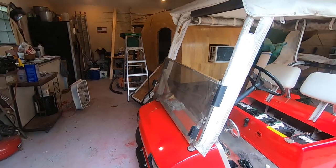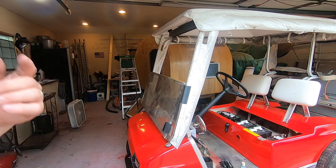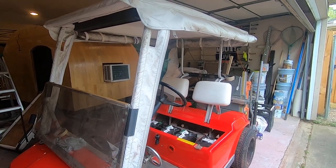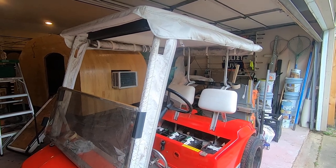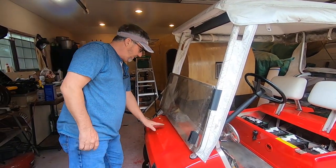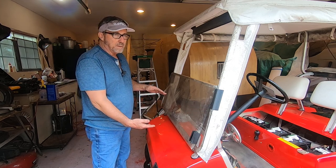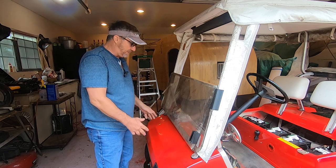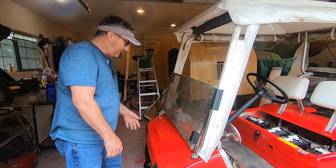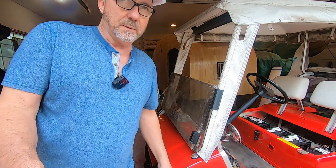In the other video I had to reshoot the cowl because I put it on too fast — you're supposed to shoot a little bit, let it dry, shoot a little bit, let it dry, and so on. That's what I did with this one. You can see a nice sheen there on the side, but it had all kinds of divots. There's a big indentation under here — I took a board and put some contact cement on it, let it dry, and stuck it up under there. That gave it a more solid structure because it was old and sloping — 34 years old. It looks better, not best, but I'm okay with it.